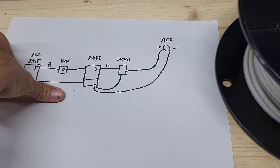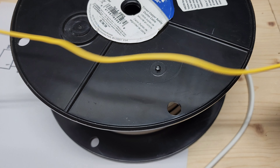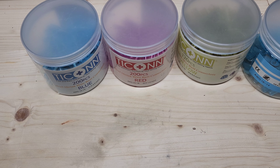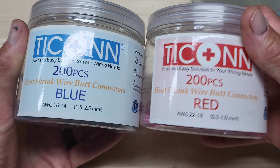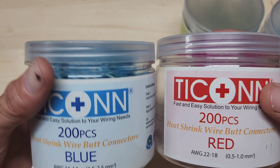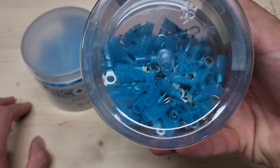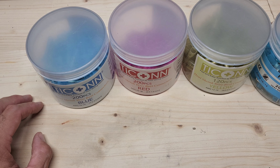Past the fuse box, you need wire for the leads coming out of switches and accessories. I use Ancor Marine 14-2, AWG 14-2 duplex — 2-in-1, yellow negative, red positive, enclosed in a housing for extra protection. If I need to run a single jumper coming off a switch into the fuse box, I'll sometimes strip the duplex housing and pull out a single strand of 14-gauge.